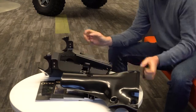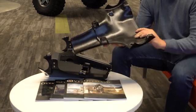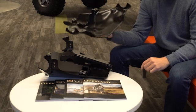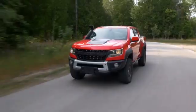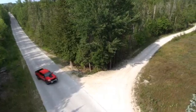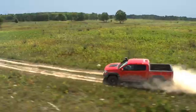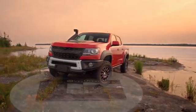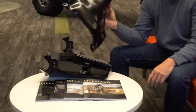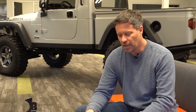Whereas our new component — if you can imagine this — is only two and a half millimeters thick. It's six pounds and rated at 215 KSI, meaning 215,000 pounds per square inch to permanently yield this. It's remarkably strong and remarkably light. It just doesn't weigh anything, and it's honestly the perfect skid plate material. We look forward to it in our new JL bumper as well as a lot of additional skid plates.